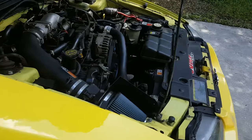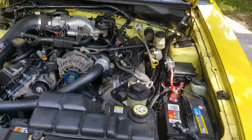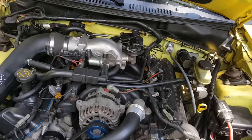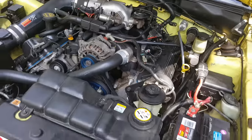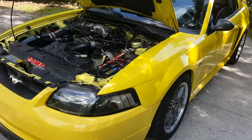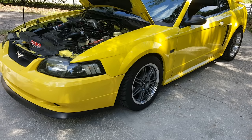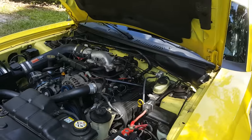If you have full bolt-ons — make sure you have the intake right, full plenum, throttle body, everything done — these cars are definitely capable of seeing 265 to 275 at the rear wheels. That's with full exhaust and no cats, what they call an off-road system.